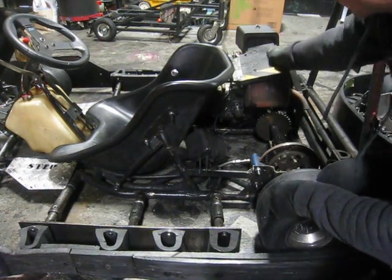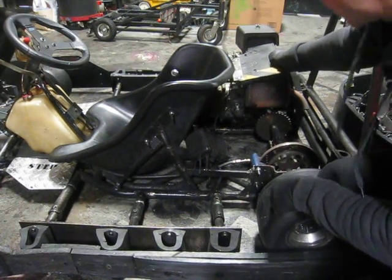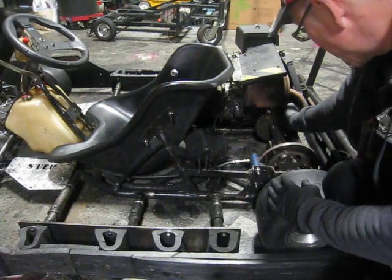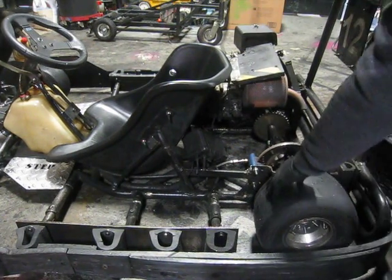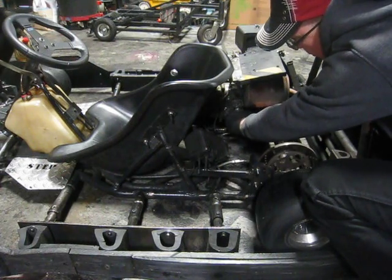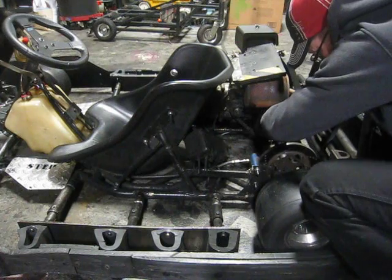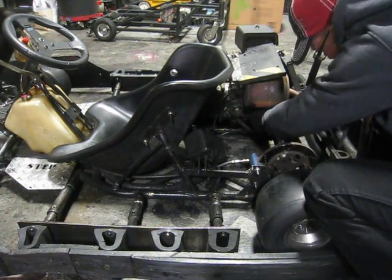Just check to see if the engine is tight, like if the engine bolts have come loose. If the engine's tight and you can't wiggle it back and forth, and the sprockets are tight, then all you have to do is just get the chain started — put it on the small sprocket like that, and get it started on the big sprocket on the bottom or on the top.